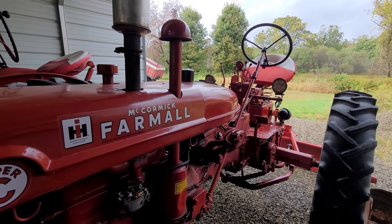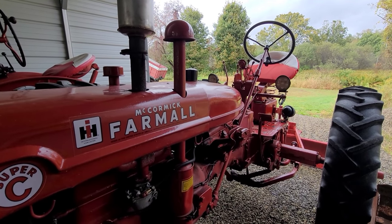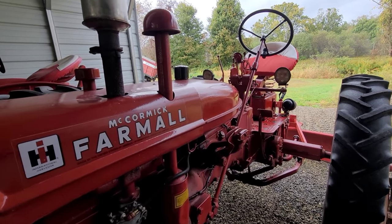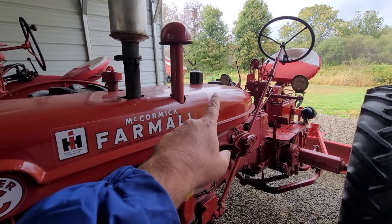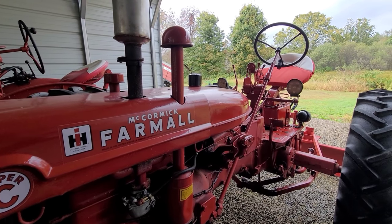Since I'm not going to have to pull this tank, I thought I'd talk about what I would do if I did. First things first, obviously I'd remove the tank. Second, before I removed it, I would drain it out with a garden hose — not a pressure washer, you don't need that. You just need enough water in there to get back behind the baffles.